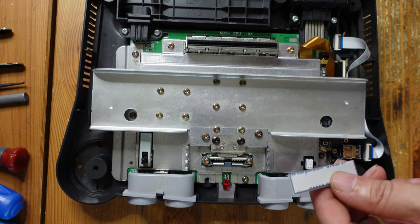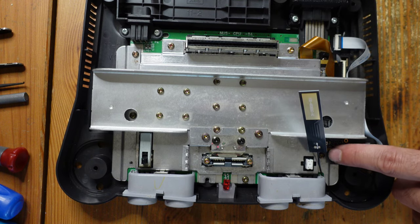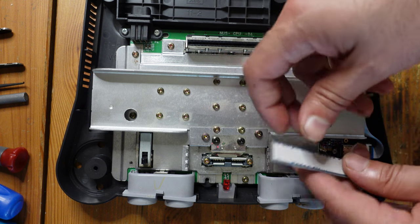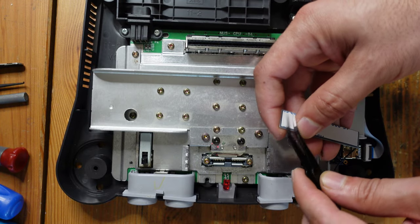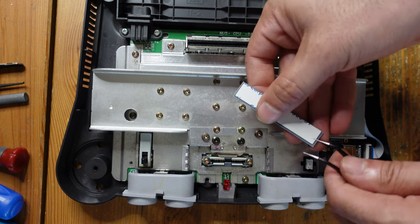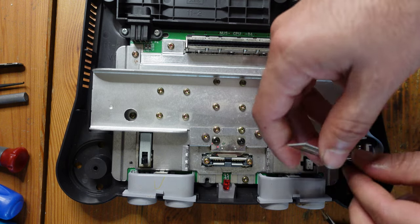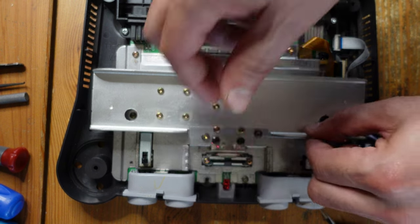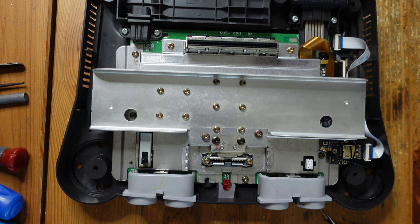One final step I forgot — this little Wi-Fi antenna. It plugs into a socket right over here, and I did that off camera because these connectors are super annoying to get on. Now that it's on, we just attach the antenna, take off the double-sided adhesive, loop it around, and locate it right over here onto the heat shield.